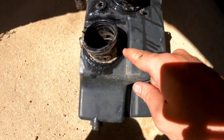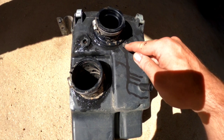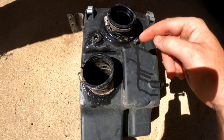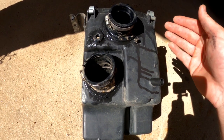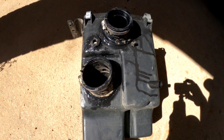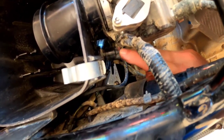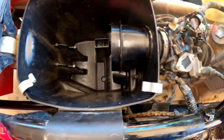Once you get your airbox out, you're going to want to get your black silicone and go around all the places where water could get in. I actually forgot that little spot - there's a plastic rubber grommet that slips through the airbox, I have to go back and get that real quick. Just put silicone all around it - I'm going to do two coats after this one dries just to be safe. Let it dry for a few hours in the sun. On the air sensor, there's a little rubber piece that pops out - before sticking that back in, put a bead of silicone around it.